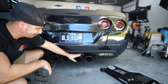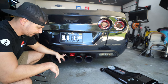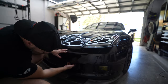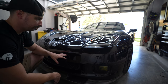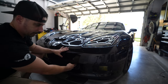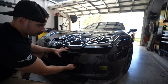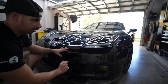That also explains why those exhaust tips sit further out — I'll get that fixed soon. Now for the more challenging part: the front. You've got to remove the bumper, and I believe there's some drilling into the bumper brace. This part's trickier — I need to get into the area behind the bumper where the bracket is, drill into it, use the hardware I bought, and also cut a couple sections of the honeycomb grille so the lock nut on the tow bracket can clear.